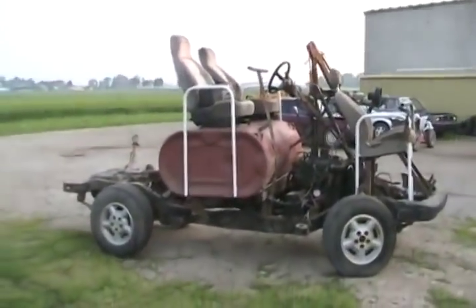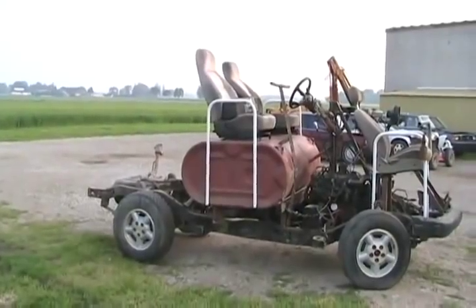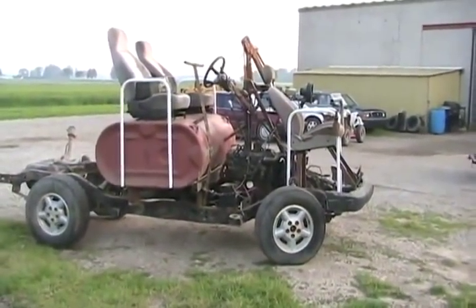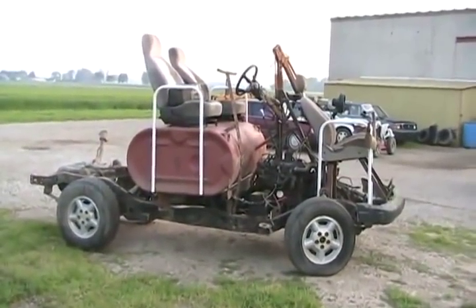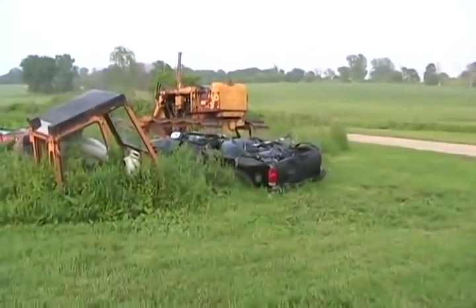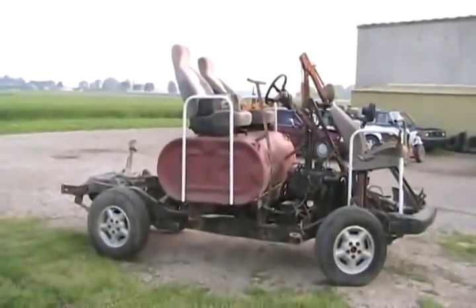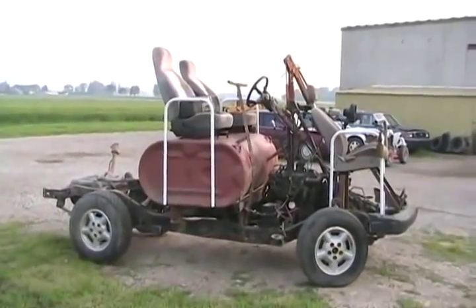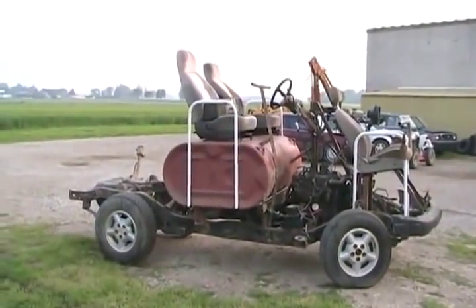Center of gravity is very low in this vehicle, so it's very unlikely to roll. I tried going around fast corners and all it does is slide. What I did was I moved the Toyota motor back two feet from where it should be, and then I dropped it by a foot. Since there's no upper body in this thing, it's got a very low center of gravity. It would actually make an awesome track car. It does feel really trucky, more like a tractor, because it's got stiff suspension when there's no water in it.